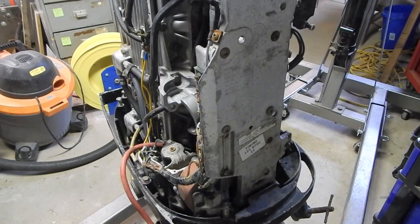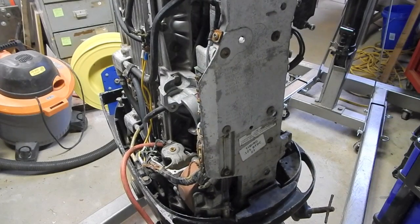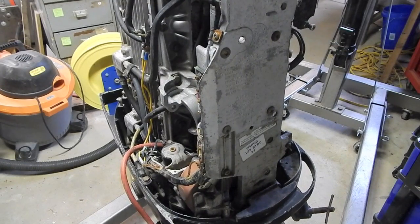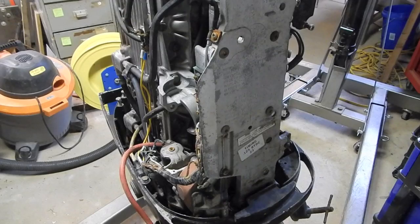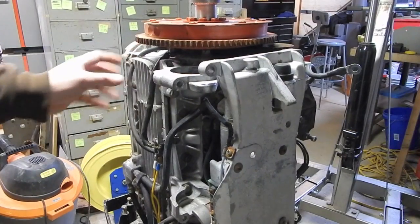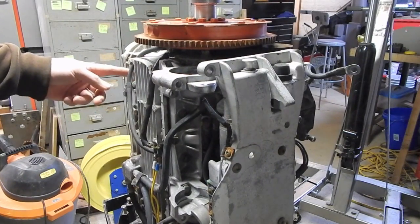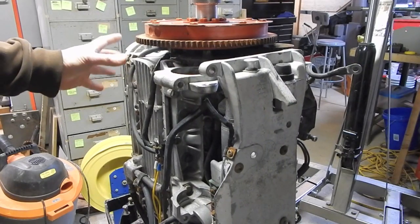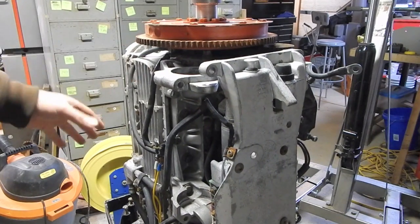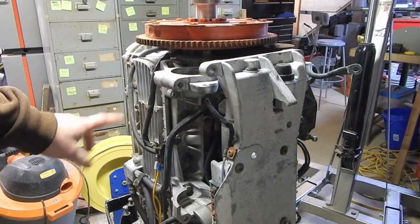They did talk about how this motor could have a catastrophic failure if it was not cooled properly, and that typically your top cylinder, number one up here, so top cylinder is number one, bottom's number 6, can grenade and blow a hole right through the piston, and even in some cases, I guess, make holes through the case. I guess the reason number one fails is that it's going to be the first one to overheat if you have a problem with the cooling system. So it's very important to make sure that the water pump is working correctly in this unit.